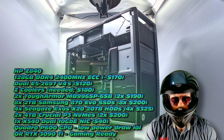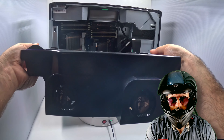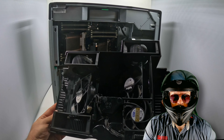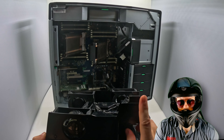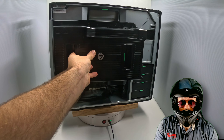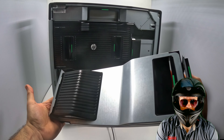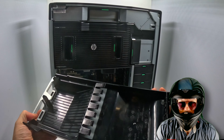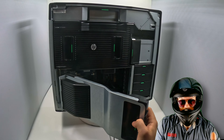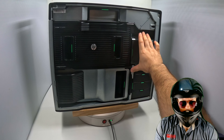One last little detail — this CPU fan module can be a little tricky. On this particular Z840 I have had problems: it doesn't always make good contact, and when it doesn't, the fans start racing. Just make sure this little connector here makes excellent contact. The seating on it can move a little bit — I suspect sometimes they get damaged from normal wear and tear. Give it a good nudge in that top right corner. If reinserted without pushing the top corner properly, it will actually give an error code. This lower chamber shroud is quite a well-engineered piece, but I've not been able to run it on any of my systems because it doesn't clear the GPU — not even something like a GTX 970 works. If you're running Quadro cards it does help retain good airflow in that lower bay, which is important for PCIe slot function.